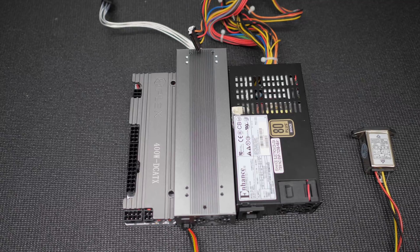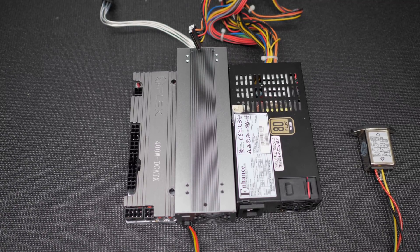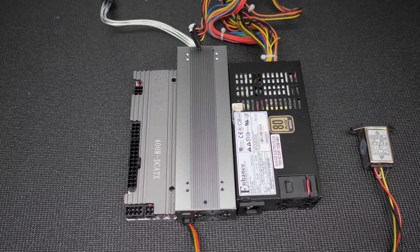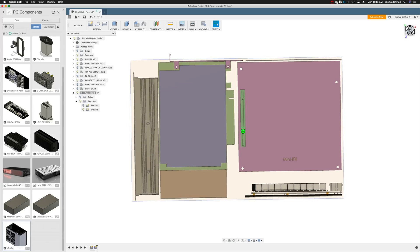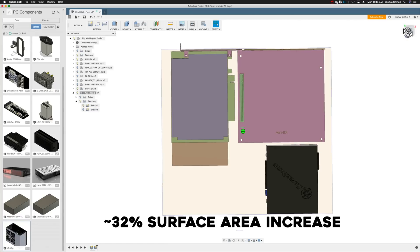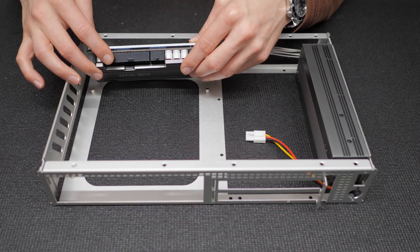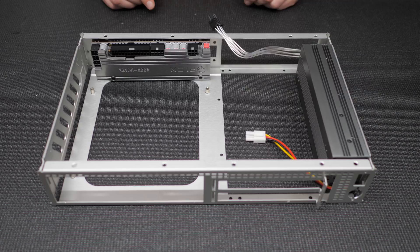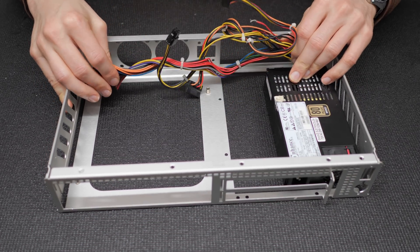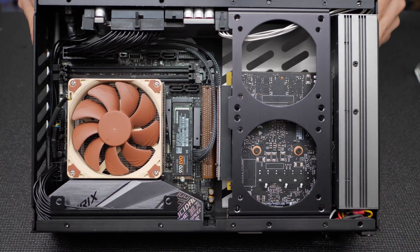Fair point. It's true that apples to apples the entire setup isn't much smaller than a similar wattage total power supply solution, but it's the complete volume that's affected. By breaking up a power supply, you can stuff the pieces into nooks and crannies that already exist, rather than creating a void specifically for one big power supply. For the cable argument, you can place the DC-DC component closer to parts and not have to stretch long bundles of cables across your case. In the small form factor world, every millimeter counts.